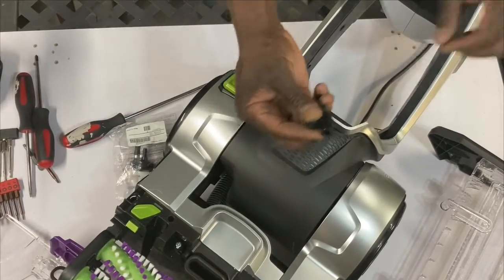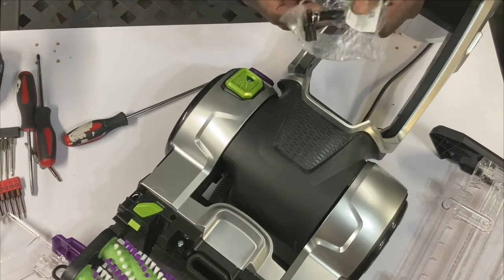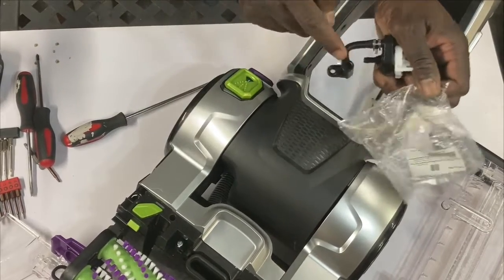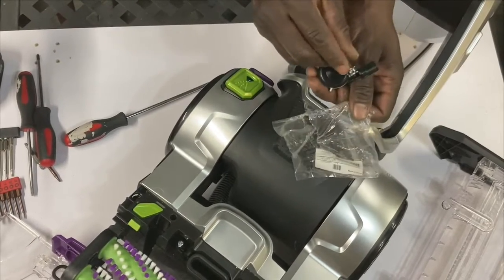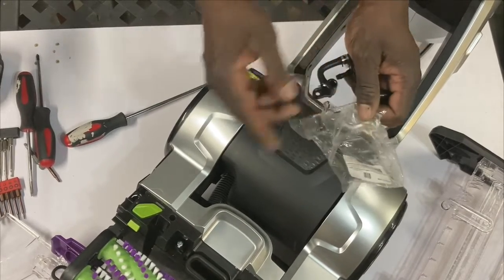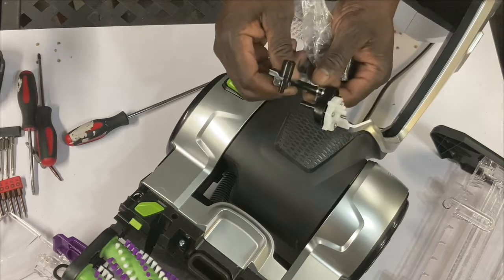Unfortunately, guys, they don't just sell this part. They actually sell the entire pump. So the whole pump would have to be replaced, but there are times when I've just replaced this piece here, just this piece alone, okay? It has clamps, and you can get a needle-nose pliers, squeeze, pull, pop this piece out, pop it on, make the job easy. Or you can replace the whole thing if you believe that the pump itself is part of the problem, all right?